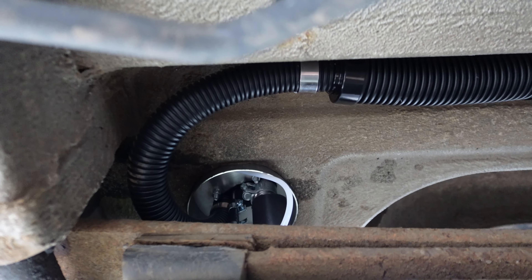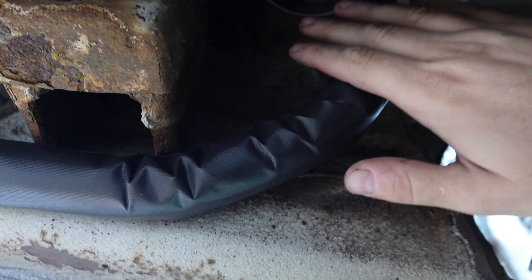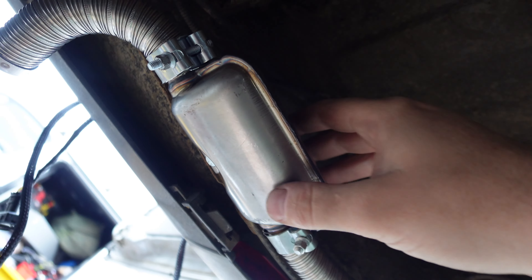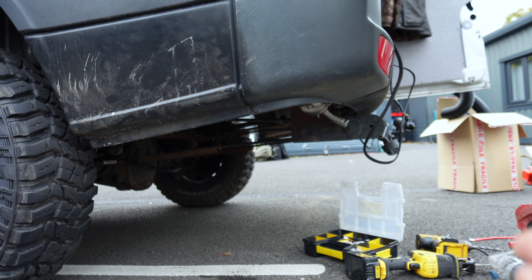As you can see here, we've got the turret coming through, the airbox out of the way, and then we've got the diesel heater. We've put this shroud on - we don't really need it because there's nothing to protect from, but why not? That comes down, round, bolted to the bodywork here, and a nice little kink down and out and away to atmosphere. From the outside, all you can see just there is the tip. Whether it's the air intake or the exhaust - please make sure that they are going downhill constantly, because the last thing you want is road spray or going through a big puddle, and water collecting and going down in and just holding, or going up into the chamber where all the burning is done, because you're going to get failure.